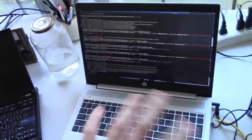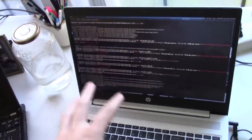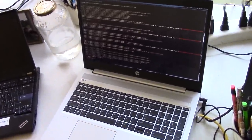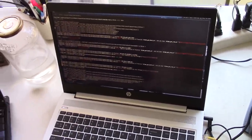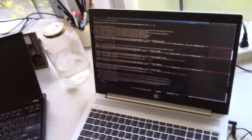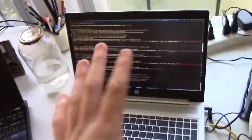But even if that's the case, secure boot, once I finally got my operating system, my hard drive in here, booting into the operating system was a huge pain. These new computers that have UEFI might not even have traditional BIOS, or they might make it really hard to get to traditional BIOS. You have to go through all these settings. Sometimes you cannot do it if your BIOS is locked. But I almost expected this to be that way because this is issued by my employer. Thankfully, my employer, they're all a bunch of boomers, so they don't exactly know how to lock all that stuff down. But it can be done with UEFI. It can't really be done with traditional BIOS. So that's one of the reasons I really hate UEFI.